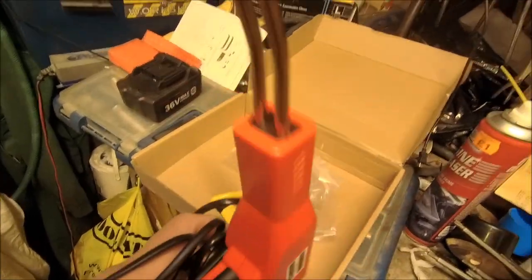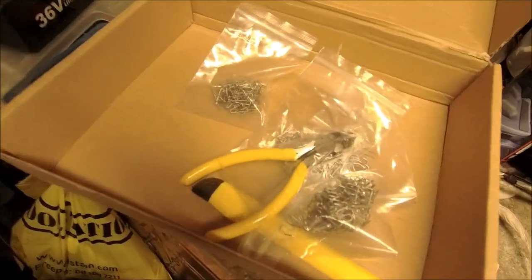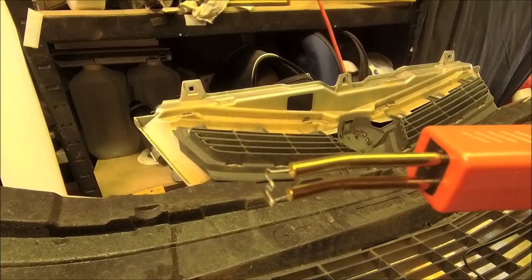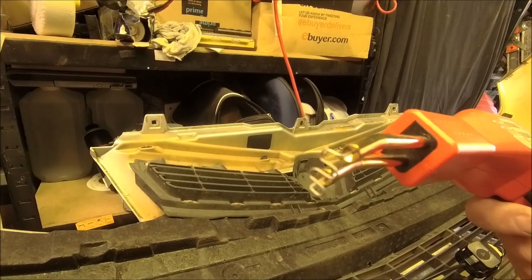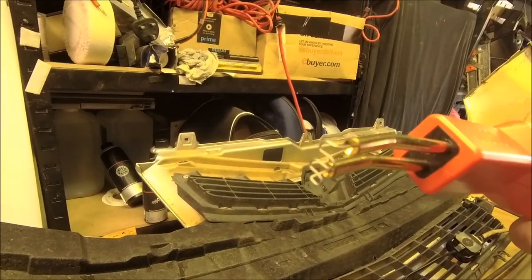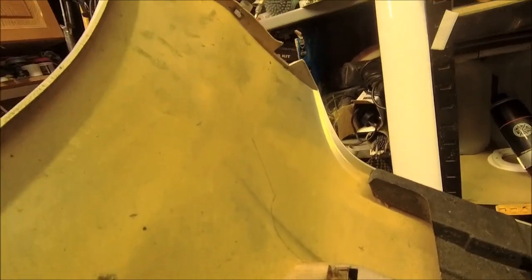We have our finest 'Chinglish' plastic welding kit — the gun and all the bits I need, including some side cutters. These are the little staples I need to be using — they're a zigzaggy shape and they basically weld it together. When you press the button they heat up, and you just need to gently massage them into the plastic crack, sealing the end first and then working backwards. Need to concentrate — bear with. There you go, that's all you do — just melt them into the plastic. You need some good penetration but be careful you're not going through the other side. The end bit is sealed, now just need to stitch it at intervals all the way down.